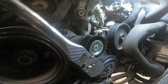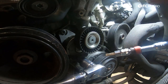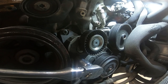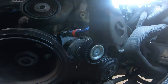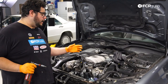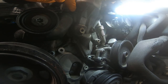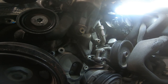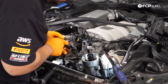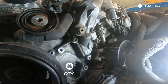Put the 17mm on our ratchet to release tension as if we were removing our belt, take our T45, feed it in there, break it free, and zap it out. Then release the tensioner and get the top bolt off. Now with the tensioner out of the way, we can work on actually removing our oil filter housing. We have a couple more T45s — one right underneath the filter housing neck, and three more down below. Before removing the housing, I'm going to remove this hose grommet piece off the filter housing. There is a total of five T45s holding on the housing.